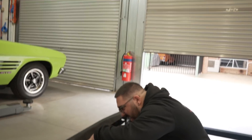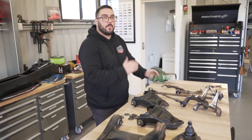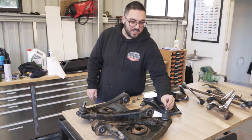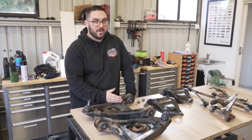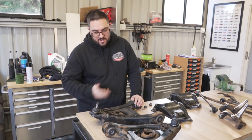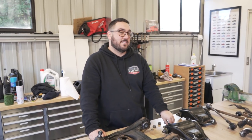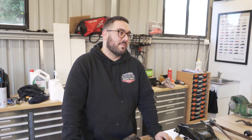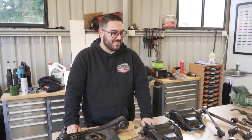We've got some parts — a lot of parts. We got everything pressed in, thank you to Peter for doing it all for us. He pressed everything out and pressed everything in. We didn't paint it when it was all out because he said we'd probably scratch it while putting it all in, so that's fine. We'll just mask it up and paint it. Our goal is to get that assembled today with the engine in — it's going to be a big day. We've got to lift the engine, take the sump off, put the other sump on, put the extractors on, figure out all the engine mounts. It's going to be a fun day because everything's new so it should go together well. It is cold — let's do it.